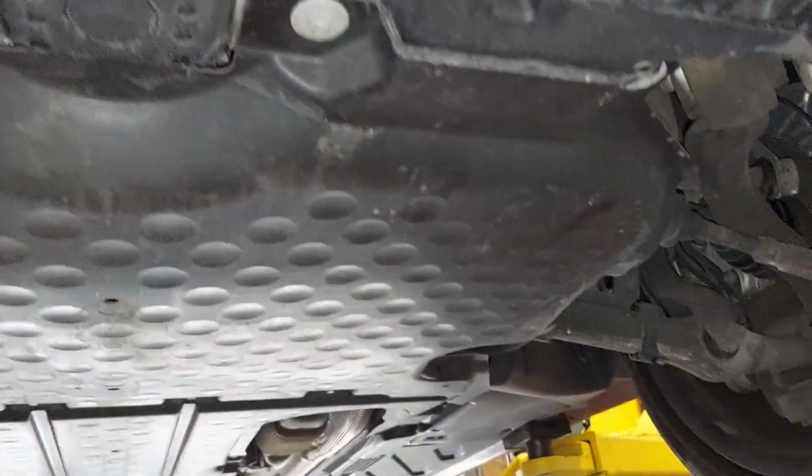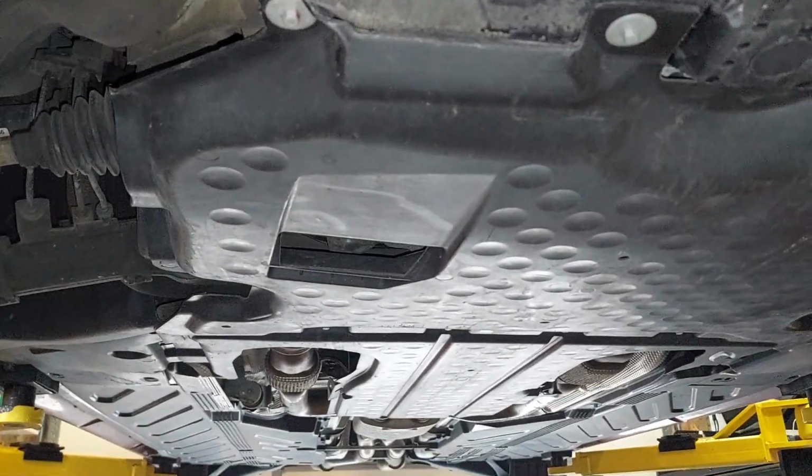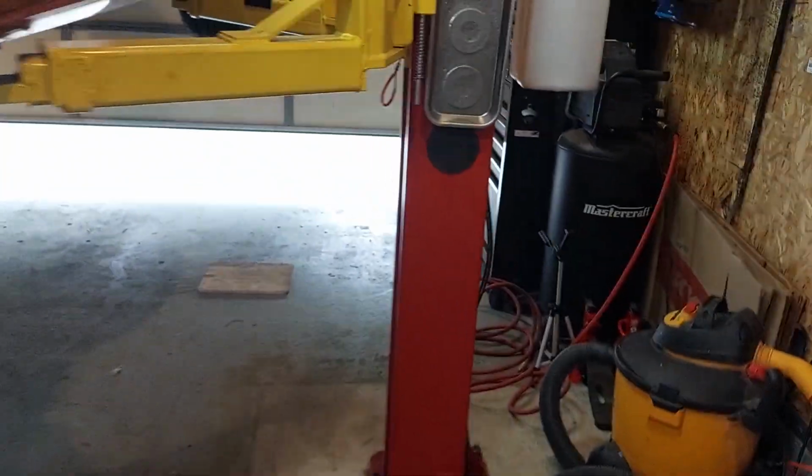So you have the vehicle running. There's your new washer that you put on. It's not leaking. There's no leaks from anywhere. So you can put your beauty cover back on with your 8 mil, and then you can lower it down. Beauty cover's back on. Just put it on number 8 on a drill, and it'll torque itself real lightly. You don't need to over torque this. Okay, wheels are on, but not torqued, so we're gonna lower it down and torque them.